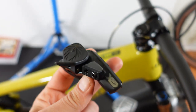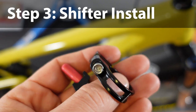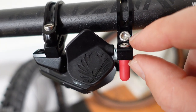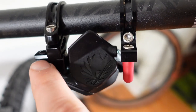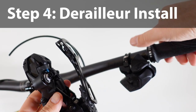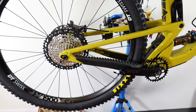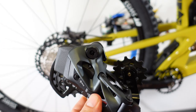The first step is to install the shifter. This is a new bar clamp with two bolts versus the old SRAM bar clamp that came with older shifters. The new bar clamp has an integrated 5mm spacer, so your shifter gets pushed down — I assume that's for ergonomics. Shift into the hardest gear using the up button to bring the cage all the way back. And surprise — we're gonna make it a SHRAMANO install: Shimano cassette, chain, and cranks with the SRAM AXS GX.